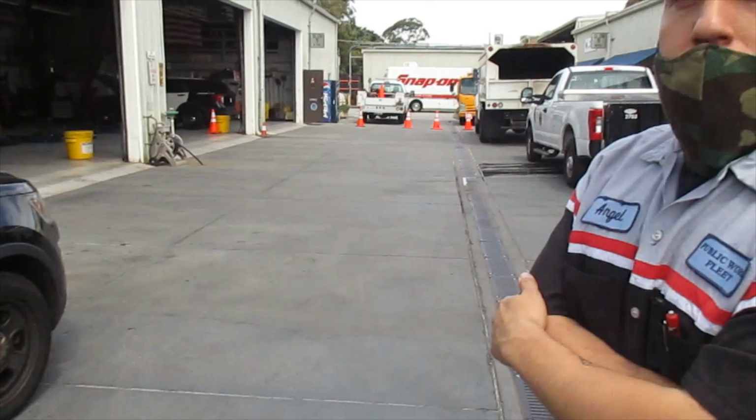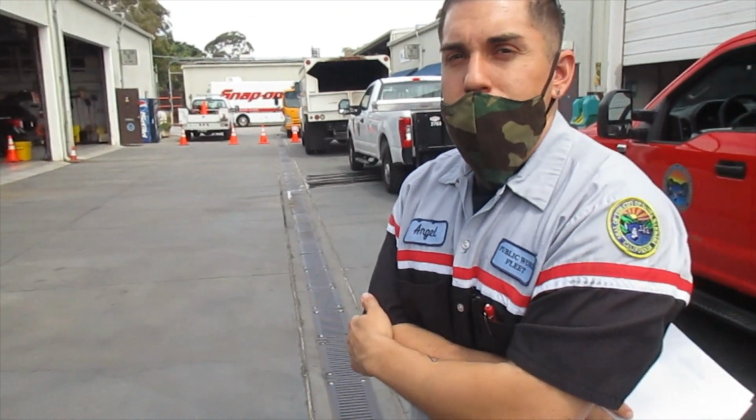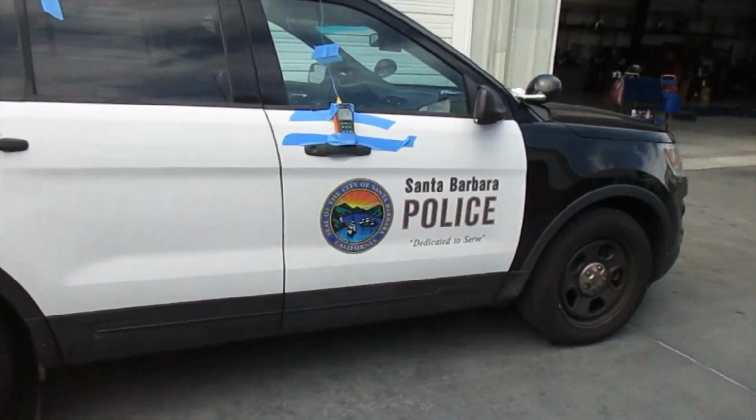Okay, so again, we're talking with Angel. Now, Angel, you had to download the update, and what you were telling me was that it has to be downloaded for each vehicle. It's not something that you can save and put on a second vehicle, right? So there's 3 updates, one for the PCM, the VCM, and the HVAC, and it's all each individual downloads, so it'll probably take around 30 minutes total. Okay, and you got to do that for each vehicle? Each vehicle. Okay.